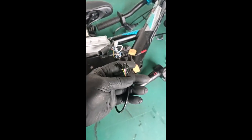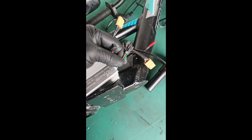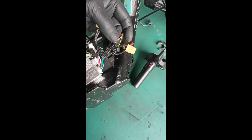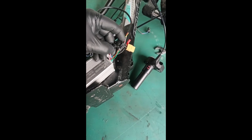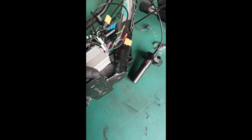The first thing I'm going to do is connect the throttle wires. The throttle wire goes to the green, orange, black, pink, and red connectors. Be aware that when you plug them in, the tabs inside can get bent. Make sure the plug slides in nice and easy - if the connector is hard to plug in, that's a good indication one of those tabs got bent.